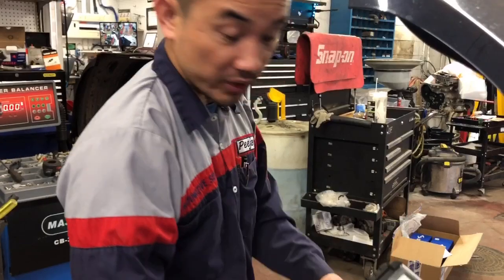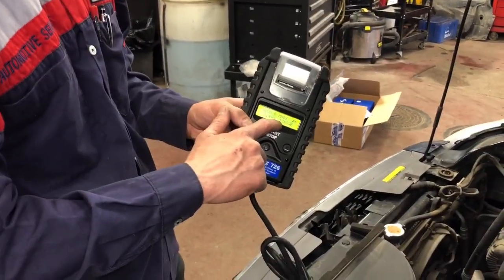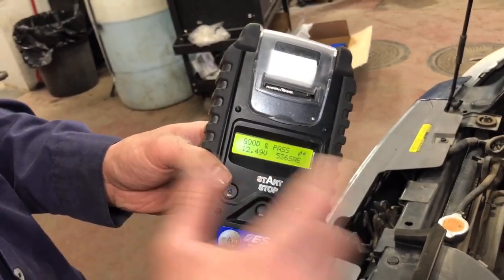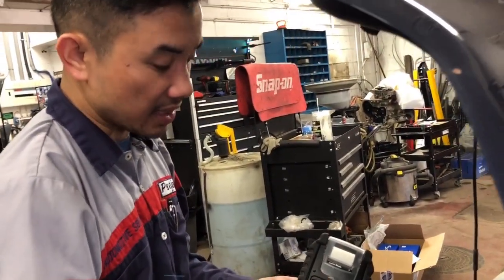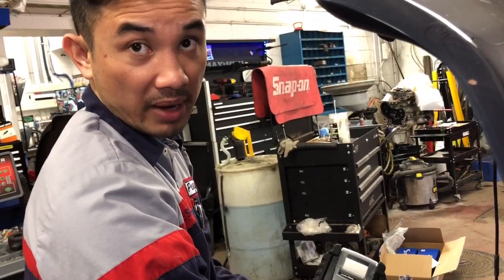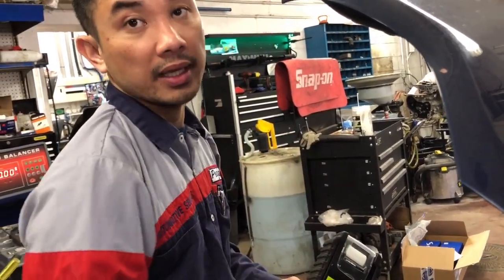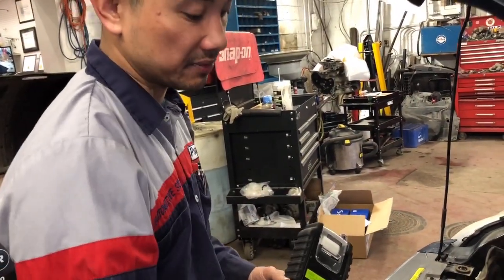With a good battery just like yours — it says good and pass. Yours is still rated 536 CCA; the battery is rated 550 but the actual measurement is 536, and it's still good and pass. So in your case, plug it in at about minus 25 — anything minus 25 and below, then you plug it in.